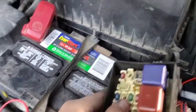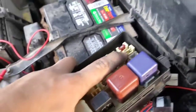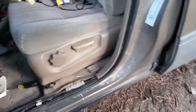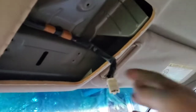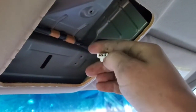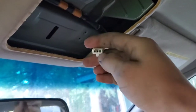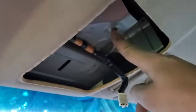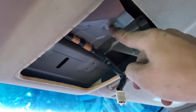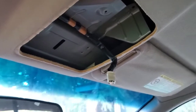I've been following the wires and checking for continuity. But before I did that, there were a couple more things I checked. I checked this right pin here, which is the ground pin. I checked continuity with a voltmeter between that and ground — I just stuck it in a hole where I could get a good ground — and it had continuity. So it has a good ground.